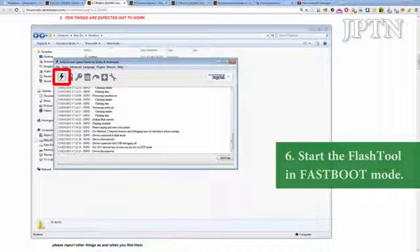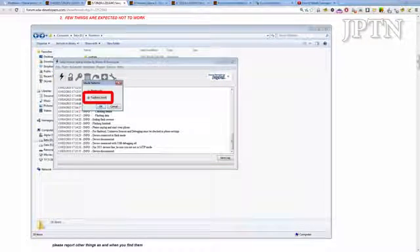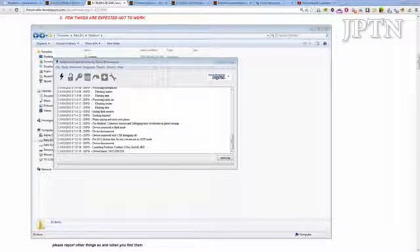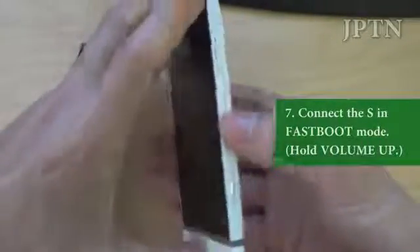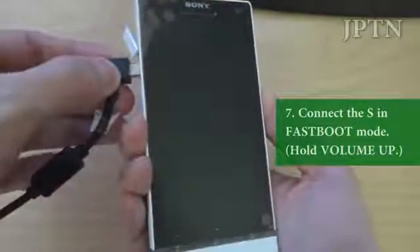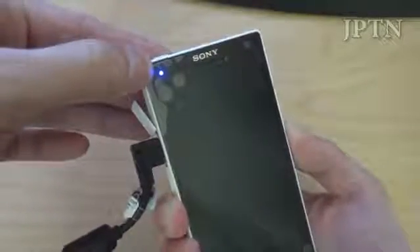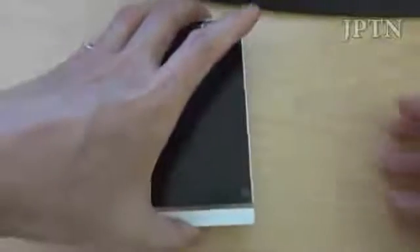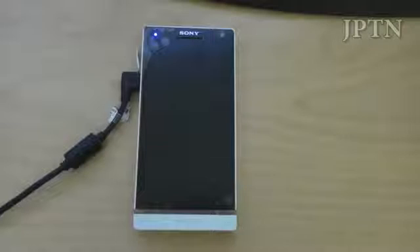Next, go into the flash tool and choose flash. But instead of regular flash mode, you're going to choose fastboot mode. So once again, this is only for unlocked bootloaders. Hold the up button instead of the down button and connect your phone. The light should turn blue instead of green. Make sure you're using a USB 2.0 port, not a 3.0. If the blue light turns off, it means you don't have drivers installed, so go back through and install the drivers properly.